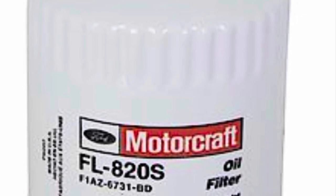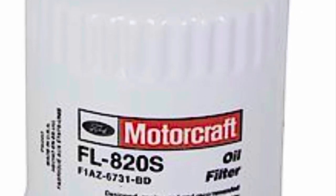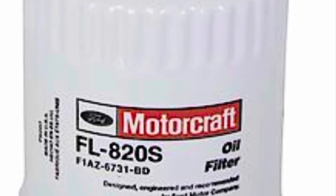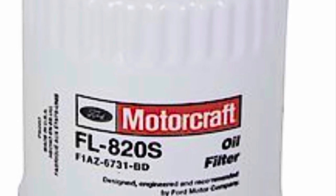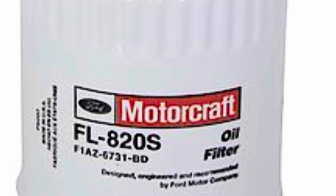In conclusion, seeing we have a good constant 5 psi oil pressure, we might as well put it to good use. Instead of trying to pre-fill the oil filter manually and turning it sideways on this 5.4 — which results in oil leaking all over the place trying to screw it back on — there's a better approach.